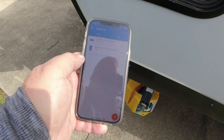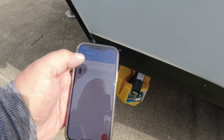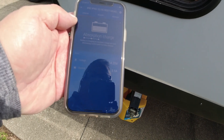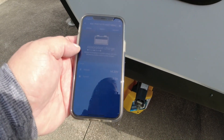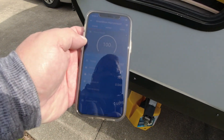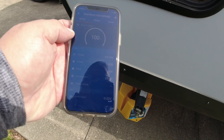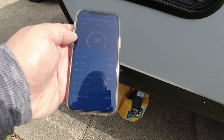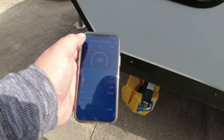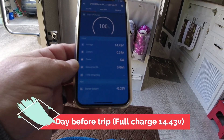I'm going to my app — I have two things: my shunt and my charger. Going to the charger, it's showing we're doing an absorption charge and it's already boosted up to 14.20 volts, so it won't take long. I'll let this run for a little while, make sure it's topped off, and then check the shunt. It's currently putting out four and three-quarter amps and dropping quickly — it was already basically at 100%. We got it up to 14.43 volts — that's our baseline for the day before we go camping.